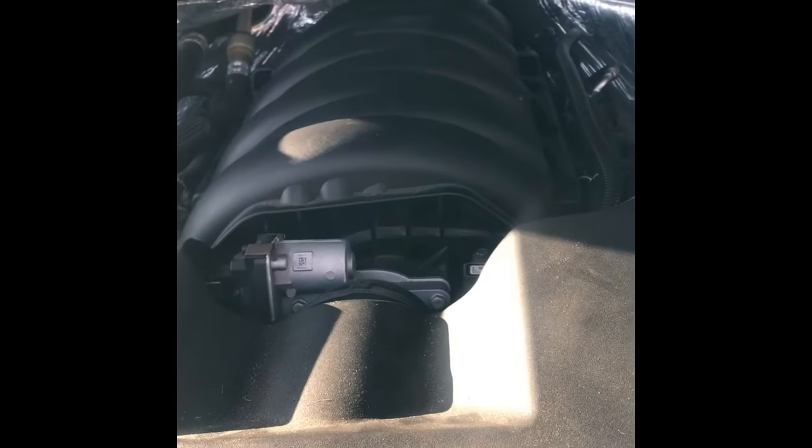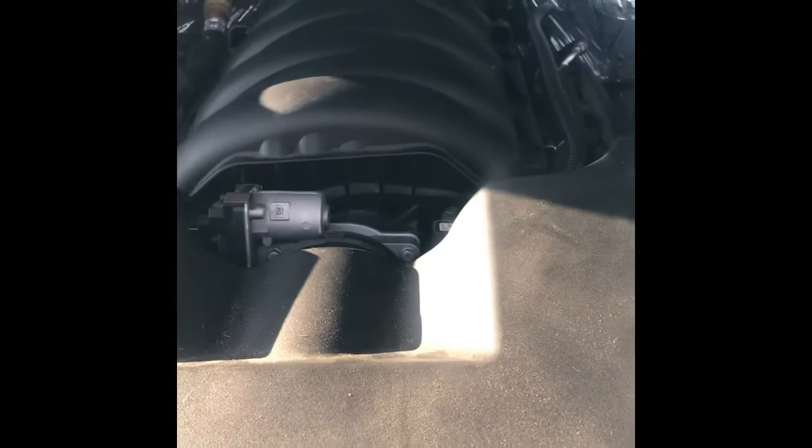You'll need a quick disconnect tool for your fuel line. I showed you in the video where I disconnected mine, because you have to lift that right side bank number 1 fuel rail out of there. That one fuel line's over the top of it, so you need to take that out so you can get to it. It's real simple. It's a $7 tool at the auto parts store. You can probably find them cheaper, between $7 and $15, depending on how elaborate a tool you want. I just got one. I think it's the 3/8 maybe. There's 2 sizes on it, but the one size was the one you needed for the Chevy GM stuff, so it worked fine.